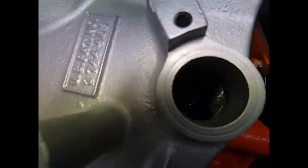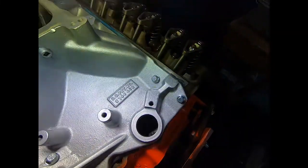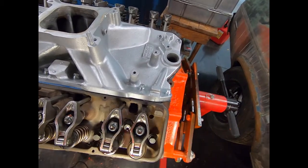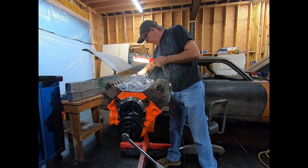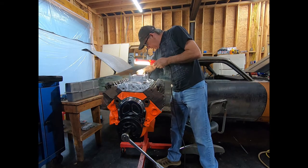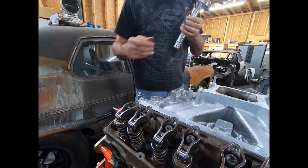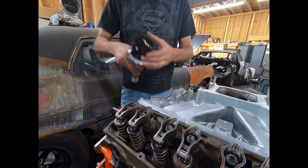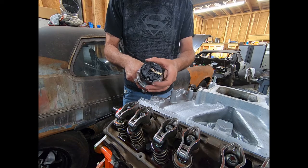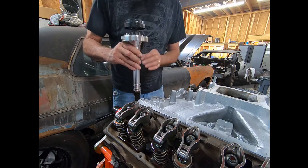You can look down in here and kind of see — trying to get the light in here. You can see where the oil pump shaft is. See the slot in the shaft right there? I want to turn that until it's pointed right here at my number seven cylinder. So I'm going to reach in here with my screwdriver, put it in the slot in the shaft, and turn that until it's where I want it to be. Right about there is about right. So now I've got my rotor button pointed where I want it. I'm actually going to turn it back just a little bit farther than where I want it, because as it meshes it's going to turn clockwise, and hopefully that's when it's going to line up with the oil pump shaft. So I'm going to turn it a little bit counterclockwise from where I actually want it.